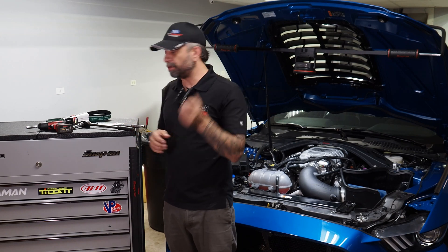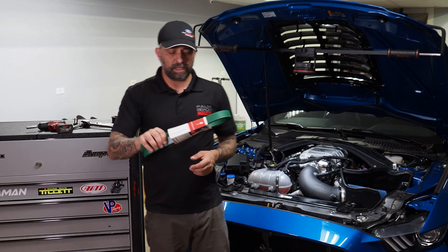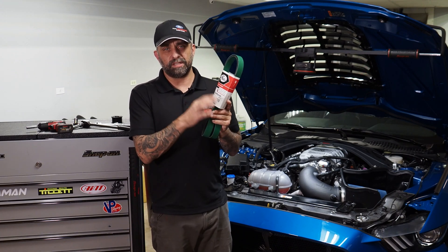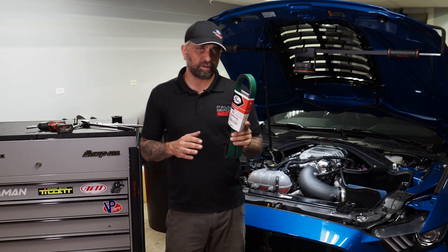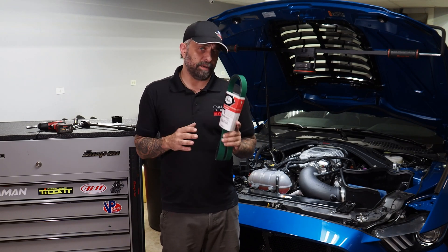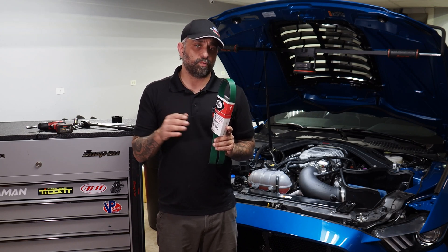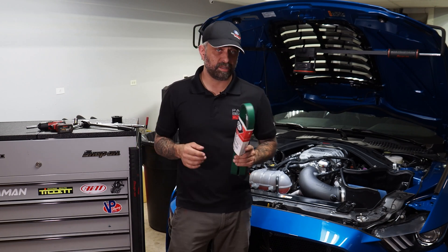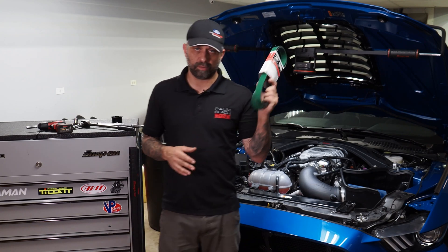Of course, you're going to need your pulley. We're going to switch to the 2.5 and the belt. This is a K080675 HD — the 670 is probably better for the 2.5. We went through the trouble of test fitting all different belt and pulley combinations for our customers. You can find that belt chart on our website; it's only valid for SPE pulleys and the Whipple tensioner, because that's what we recommend. We recommend the Whipple tensioner with any pulley change, and of course we sell SPE pulleys. Other pulleys will probably be in the ballpark as long as you're using the Whipple tensioner.